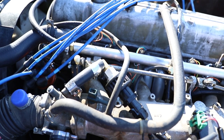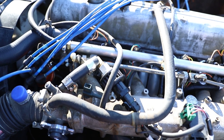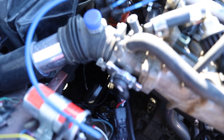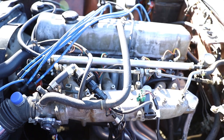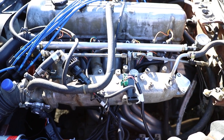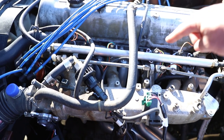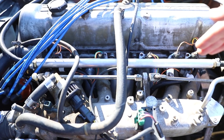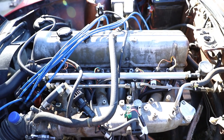I reused the 90-degree elbow that was already on the intake plenum to attach my IACV, which keeps it from interfering with the hood. The IACV is basically a controlled vacuum leak, which is what allows it to idle up high when you first start the car and control idle in cold-start situations. I also took off the lower pan and had it powder coated and remounted it — most of these cars don't have their belly pans in place. The overall installation is pretty easy, though I don't like the way the wiring harnesses are run. Ultimately I'd like to make a new wiring harness to simplify the plugs and run cleanly with the single billet fuel rail back to the firewall, but that'll come at a later date.